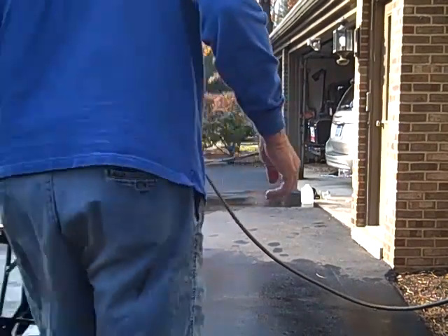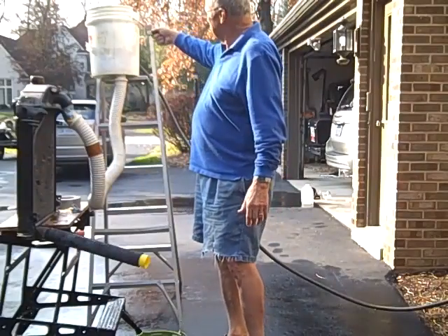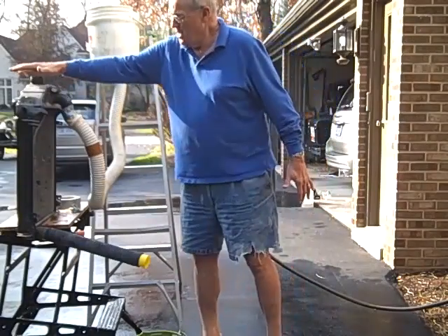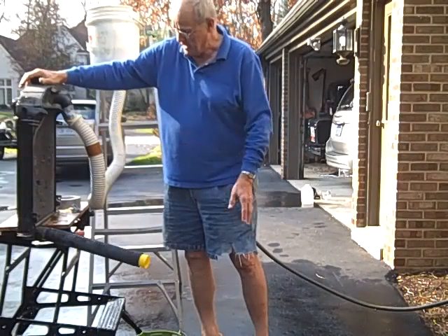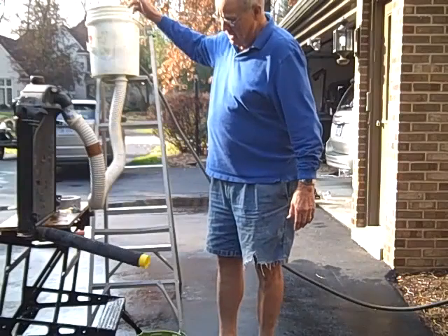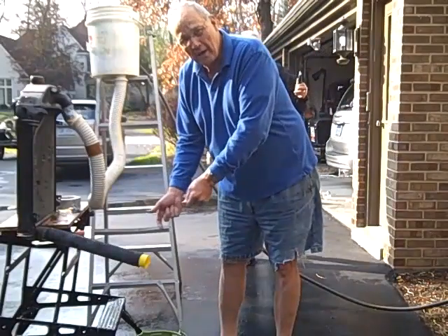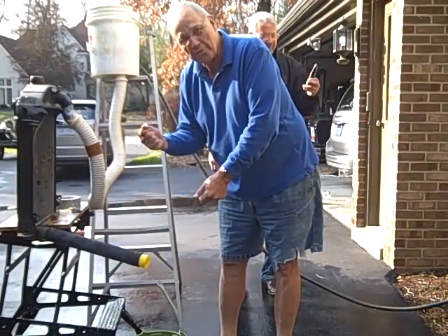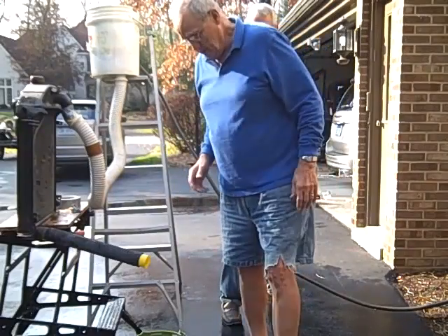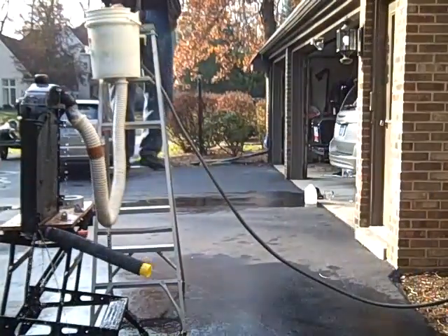This is the water supply — just water here. This is overflowing and I have a flap valve in there. We can pull that and it floods the radiator and keeps it completely full throughout the test. When we're ready to go, Jim pulls the flap valve to get the water flowing, I pull the bucket under it, and at that moment we start the stopwatch. When I pull it out we stop it — we've got the true gallons per minute.